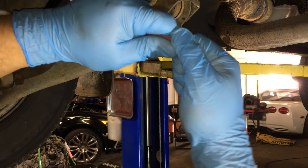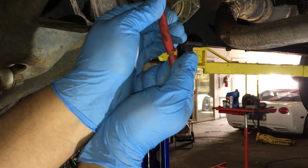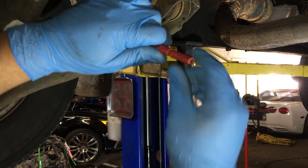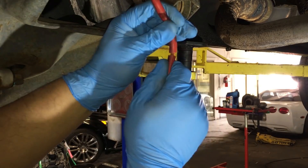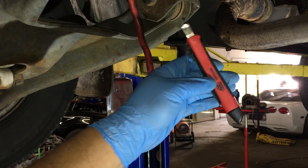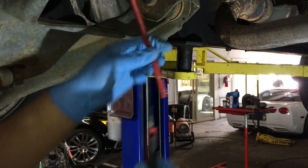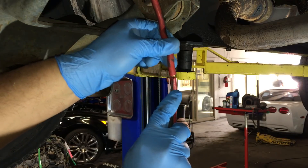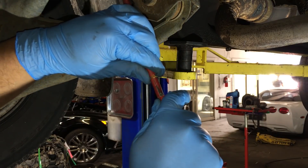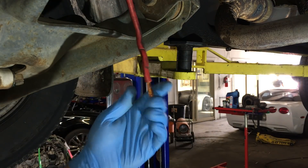That's going to cut the insulation, and you'll see a nice clean slit. If we're lucky we can just slide it off — sometimes they come off easy, but this one's going to be a little more difficult. Here's a little trick: take a razor blade and cut a small slit in the insulation downward. That opens up the insulation so we can spread it open and expose the copper wire.